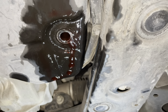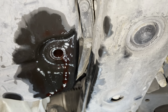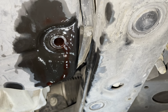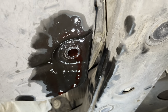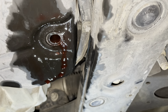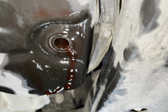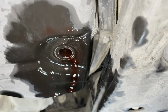I've hit the first roadblock — that pan bolt right next to the drain hole. I can't get to it; my socket won't fit and I can't get a box-end wrench there because it's just so close to the frame rail. I'm going to go buy an offset box-end wrench to see if that gets it. That bolt is just close enough to the frame rail and offset enough to where I can't get the socket in straight.